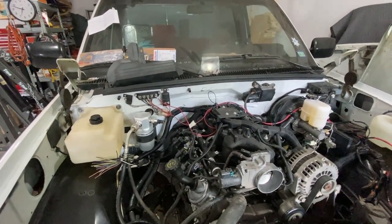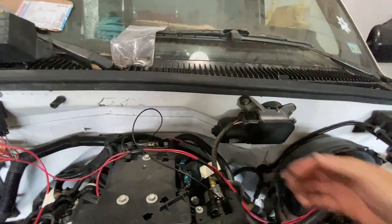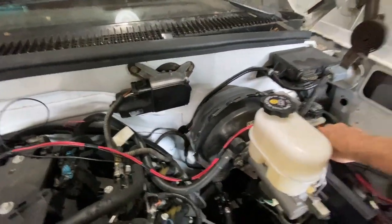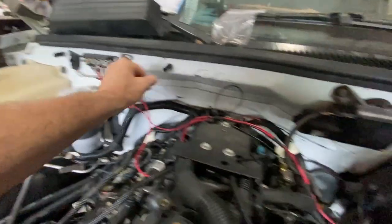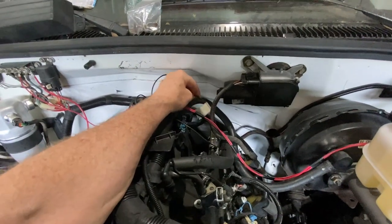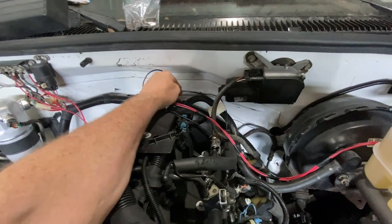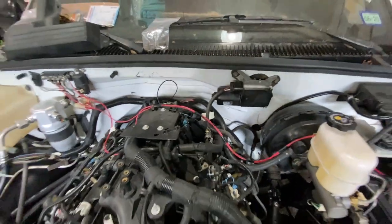Next, the pink wire for key-on power. When I strip back the harness over here, there's a cluster that comes out of the bottom of the dashboard where the fuse box is on the inside of the truck. When I opened it up, there was a pink wire that went to this second stub. That pink wire I cut, and from there I ran — in this case my wire looks black only because I ran out of pink wire — but I connected my key-on power to this pink wire, which goes directly to the fuse box within the truck.